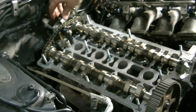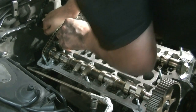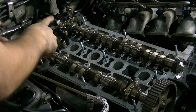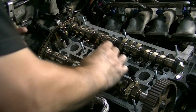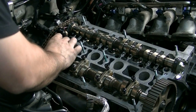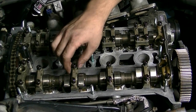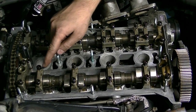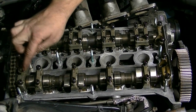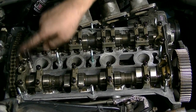Next, get our camshafts and gently try to lower them into position. There are dowel pins for your chain tensioner, so make sure your chain tensioner is properly seated over those when you put it in. Next, start putting on our bearing caps — we're not going to tighten them yet because we need to double-check our timing on the timing chain tensioner. Every single bearing cap needs to go exactly back into the same spot you took it from.